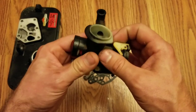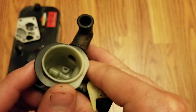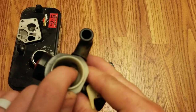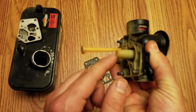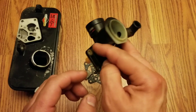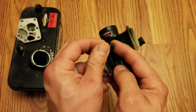Now when you take your carburetor cleaner, you want to spray through the hole that's down there in the center. That brass hole right there — get your carburetor cleaner and get down in there and clean through those holes. Make sure the tip of your can leads out into that hole and get as much carburetor cleaner through it as possible, and also through the hole here. You can spray through there as well. If you have compressed air, you can blow it out — it's better if you have an air compressor and can blow it out with a higher portion of air.